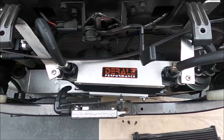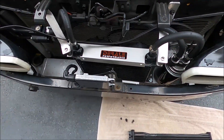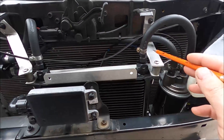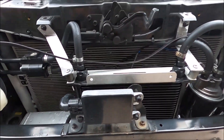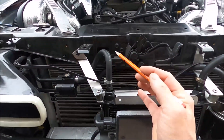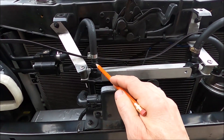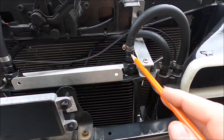I'll probably just slot these holes and adjust it. Same thing here — it's a little tilted, but super easy fix. The second improvement is I'm going to sandblast and powder coat these brackets black. I've got a little powder coat gun in the shop so I'll get that done. The third issue is these bends — I didn't necessarily like the way they came out.